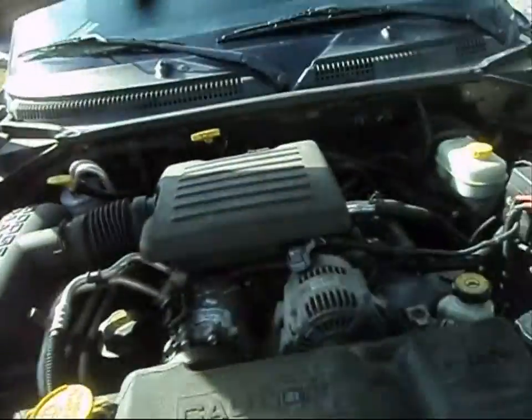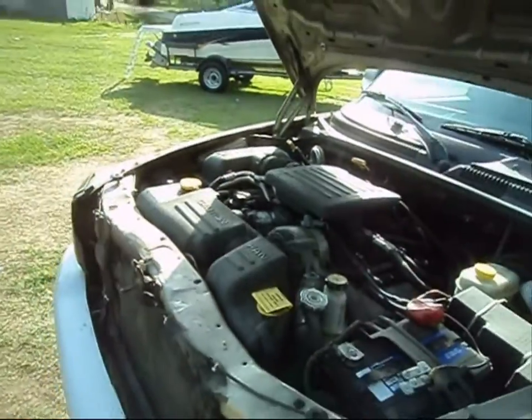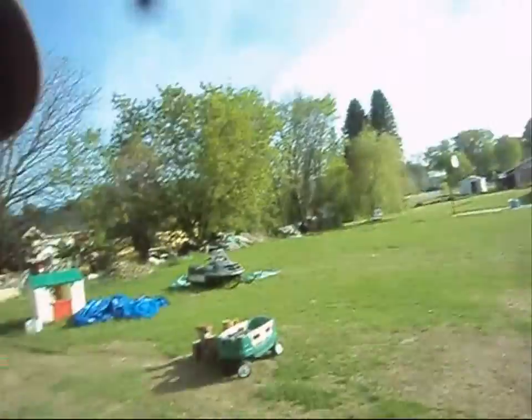If you are dealing with a Chrysler vehicle, you're more than likely going to get a trouble code, a DTC of P0, powertrain control module, P0121, which quotes, "throttle position sensor voltage does not agree." Well, hey, guess what? I don't agree with it either. So we're going to change one here today.